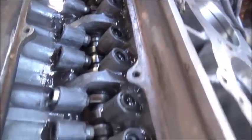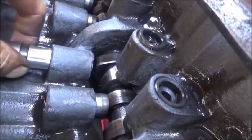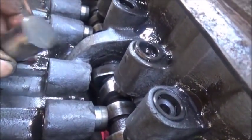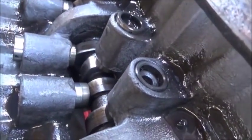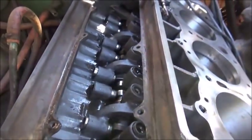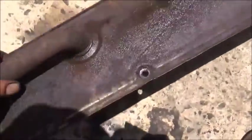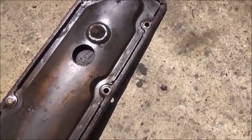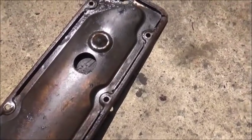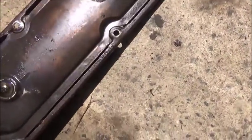The engine is nice and clean inside - not a bunch of gummed up crap. The lifters actually push out easily; anytime you can take a lifter and pull it out without having to fight with it, you're all right. The cam doesn't look too bad. Evidently the mouse crawled through this hole, squeezed out through here - you can see some of his hair - and then he was stuck, couldn't get back out.